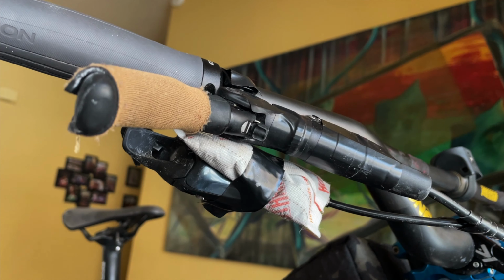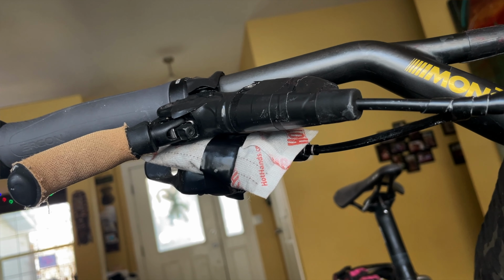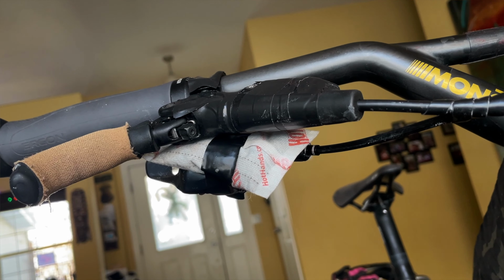In extremely cold weather, it's possible for your shifting to get sluggish, and your shifter can really get hard to push. This occurs as the grease inside the shifter thickens up due to the lower temps. If this happens, you might consider attaching a hand warmer to the shifter to get the grease back to a better working temperature range and help you shift smoothly again.